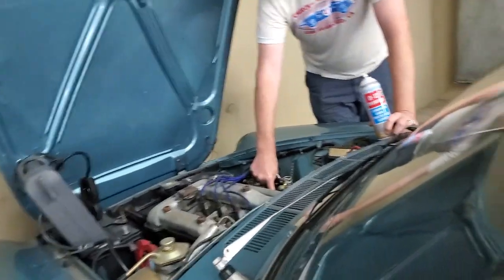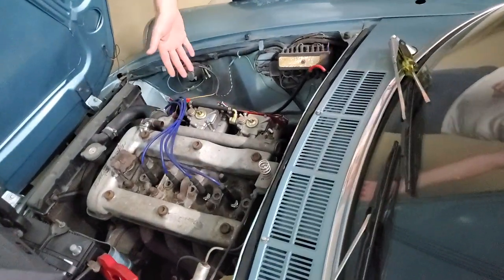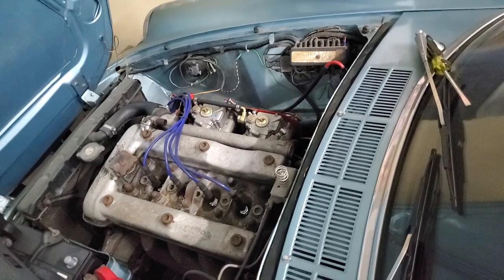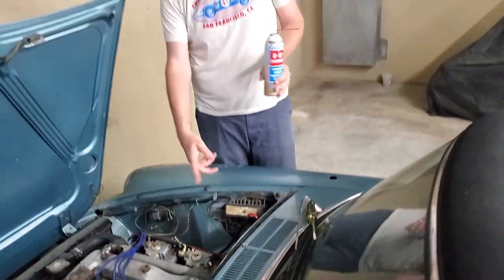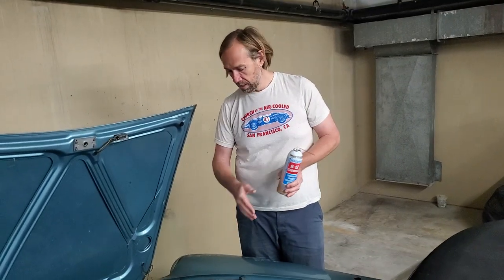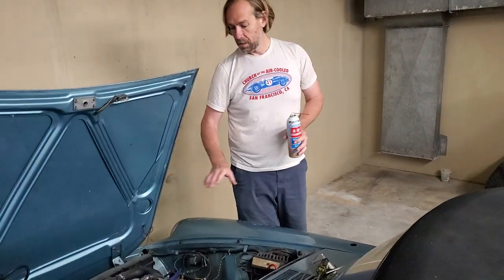So one of the main things why I didn't move forward was the new carburetors — it's so obvious. The throttle shafts are stuck. I've removed the linkage down towards the throttle pedal and it appears that it's in the carburetors themselves. I'm not going to force it.